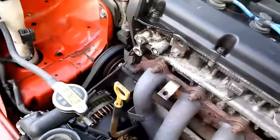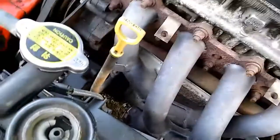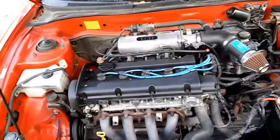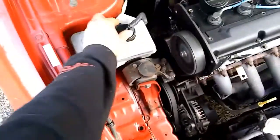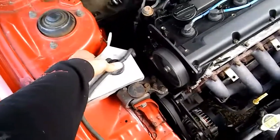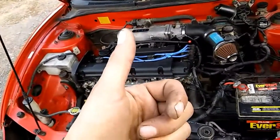Some of that rattles — I'm not sure, it could be that water pump. That's definitely rattling. That's this down here rattling. It's rattling there and everywhere else. I don't think it's the engine — the engine's pretty good. I shouldn't really be running the crap out of it. I need to change the oil in it. I'm gonna change the antifreeze in it too. I'm gonna do some things to it guys — I gotta drill that bolt out because it busted for the coolant. I'll do a few things to this today and I'll show you after I'm done with it. Like and subscribe, thumbs up guys, appreciate y'all.